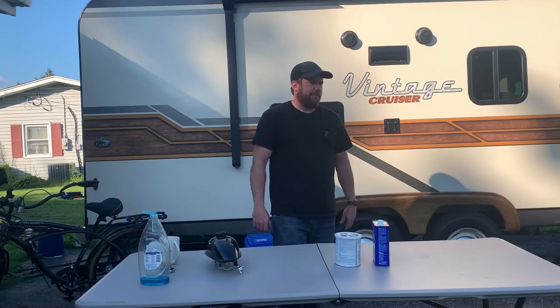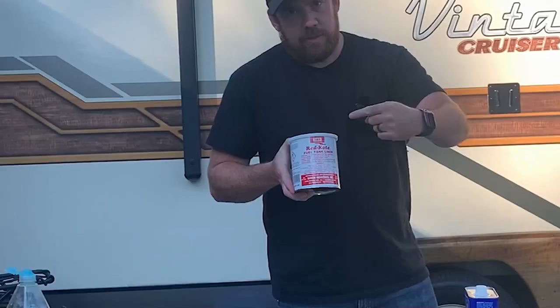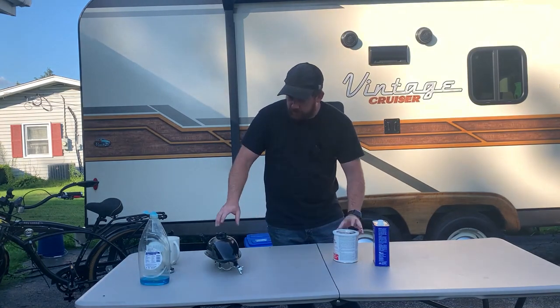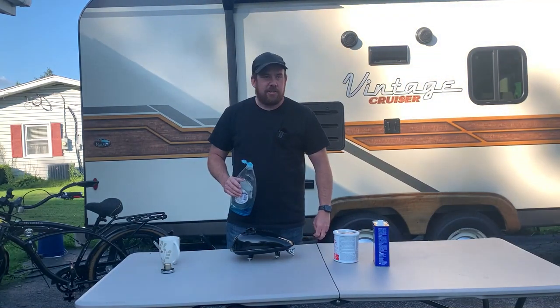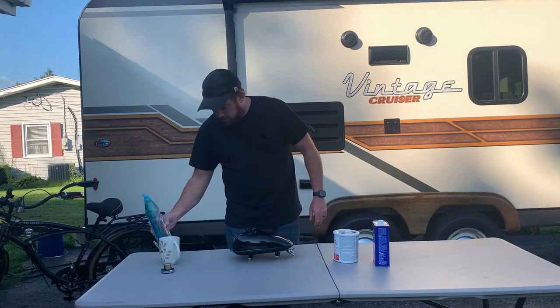Okay, we're gonna fix that fuel tank leak. So, Adam, how are we gonna do that? I don't know. I got this stuff. Zoom in right now. Red-Kote fuel tank liner. So we gotta clean this out. And how I'm gonna do that, I'll degrease it because it had a bunch of oil from a very rich fuel mixture. It's good for the seals and ducts. It's good for my fuel tank.